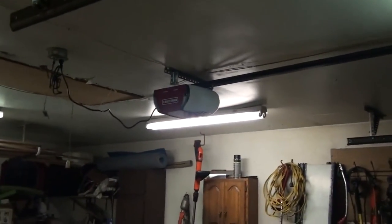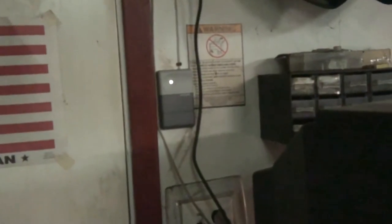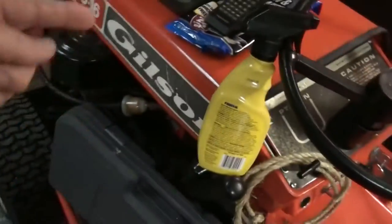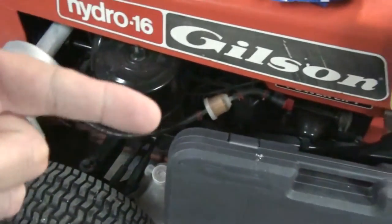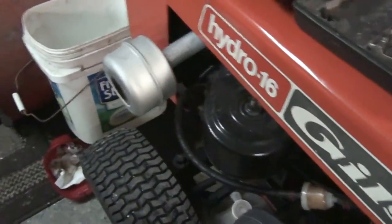Turns out I decided to put the opener in after all — it really wasn't bad and only took a few minutes. I kept everything else and just replaced the motor unit and put the arm on the door. I did manage to get the tractor moved and my wife's car in the garage. Since I couldn't use the starter, I used a rope — the flywheel has a spot for it with a little notch, you wrap the rope around and give it a yank. You have to wind it a bit awkwardly around the drive shaft, but it worked and I got it started.